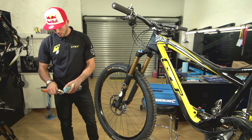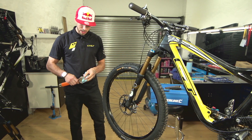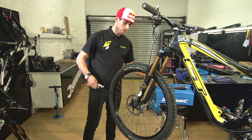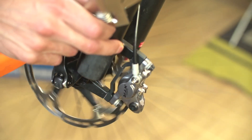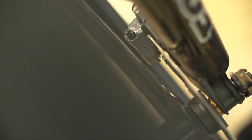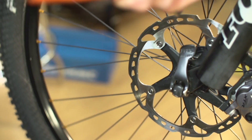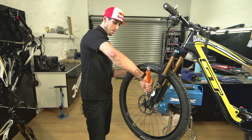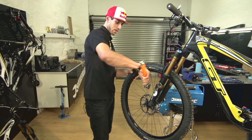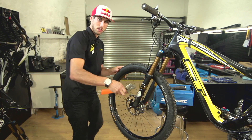Make sure the wrench is clean and free of grease so that your brakes aren't going to get damaged afterwards. Once you've cleaned the wrench, to find the bend in the disc, look down the disc and line it up against the caliper to see where the disc is touching and on which side. Once you know which side the bend is, tighten the wrench on the disc and literally bend the disc straight — small amounts at a time, checking in between to make sure the disc isn't gone too far.